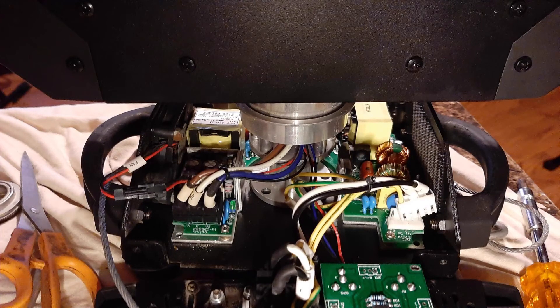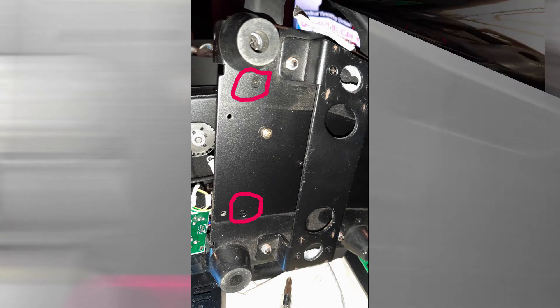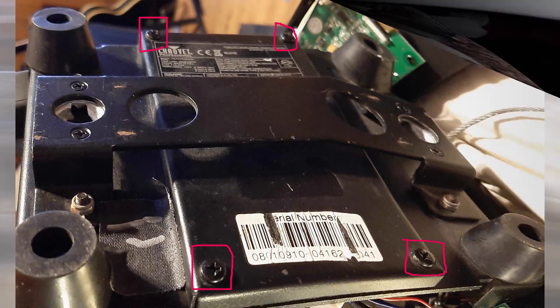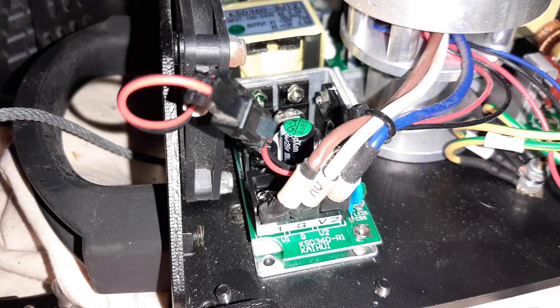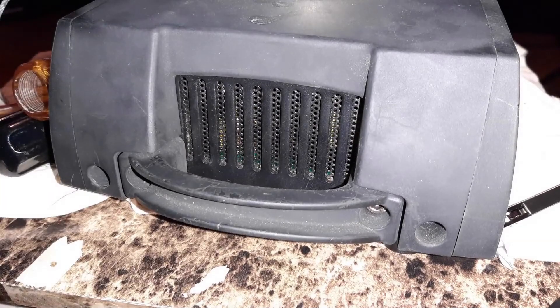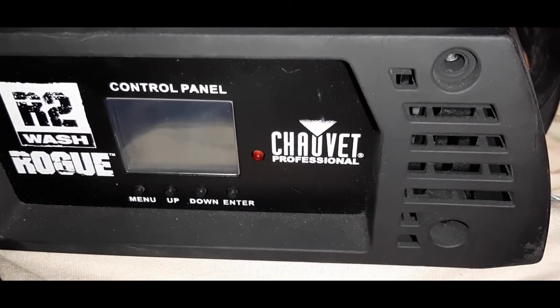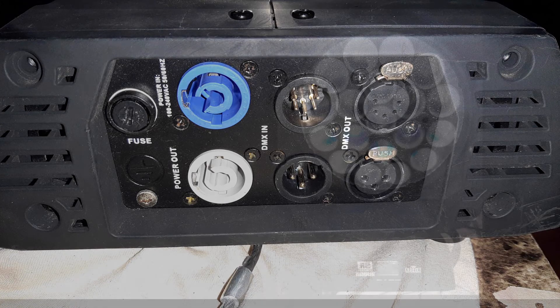At this point, you're ready to reverse the process and put everything back together. Put the recessed Phillips screws back in the bottom. Replace the ballast. Replace the foot that was hiding the one screw. Make sure your connections are back together with the plug and the wires on the input. Replace the front, back, and sides. Make sure your new fuse is in the unit. At this point, the fixture should be ready to go back into your inventory and ready for a show.